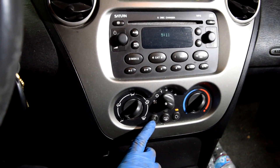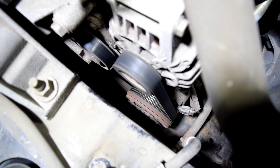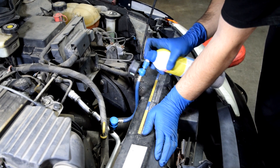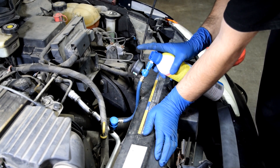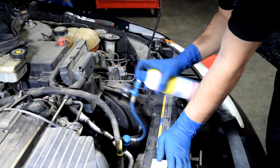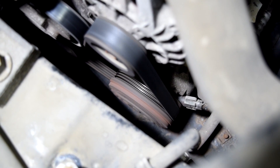Here's the car — let's turn on the AC, put the fan on max and maximum cool. Here's a look at our AC compressor, and as you can see our AC compressor clutch is not engaged. So we're going to add refrigerant for about 15 seconds. You can also shake the can — that will sometimes help the refrigerant go in easier. That's 15 seconds. Now we're going to wait a couple of minutes. It's been a couple of minutes and the compressor clutch is still not engaged, so we're going to add some more. Oh, here we go — the clutch just kicked in! So on our second run, we were able to get the AC compressor clutch to engage.